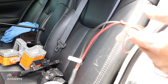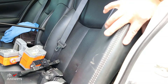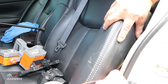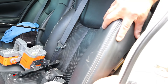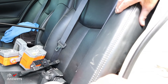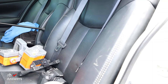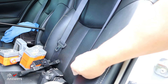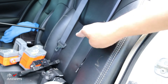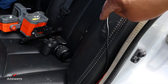So I've got the cord, and I'm simply going to push it between the seat and the frame — just push that up, and you can see how there's space. Push the cord in there as much as I can, making sure it's going to the back, not going up or down. Now, if your seat folds down, I've got a video in the description on how to route the wire inside the vehicle with your seat down. My seat doesn't fold down, so I've got to use this method.